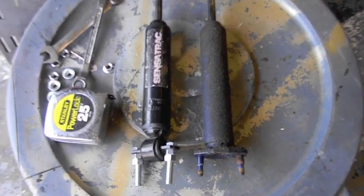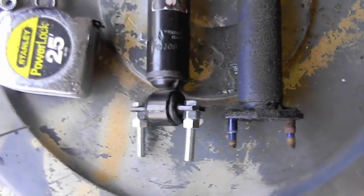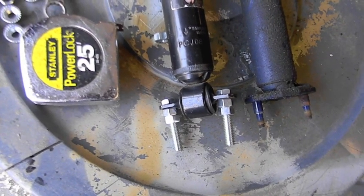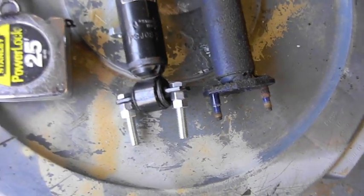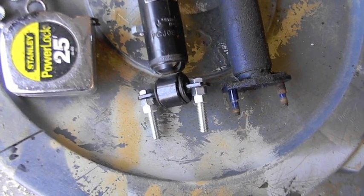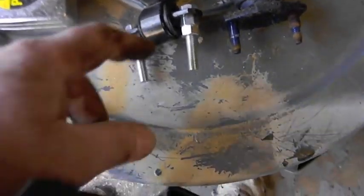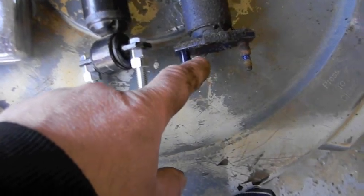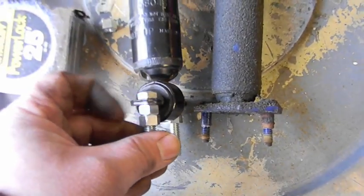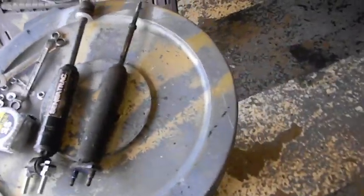This is what I've come up with: instead of using the two studs that they have pressed in there, I bought two 3/8 bolts instead of the thin 5/16 bolts they had, and I jammed two nuts together to make up the spacing difference. This accounts for the fact that it overhangs a little bit — instead of just rubber pushing there, now it sits in the rubber and it all works out the same. Let's see how it works out.